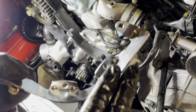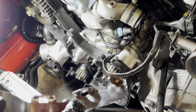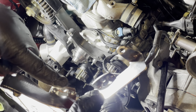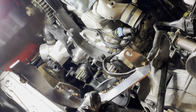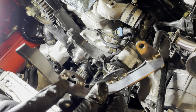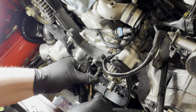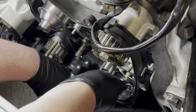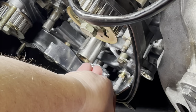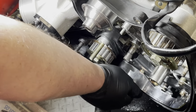The next thing to go in is this guide plate that sits underneath the crankshaft pulley - this is for the timing belt, but it has to go in first because otherwise there's no way to get it back in. It has a peculiar set of screws: one long one, a medium one, and two allen head bolts. This allen head bolt stripped when I took it apart last time - I probably spent a good five or six hours getting it out. It looks like Porsche chose the allen head bolt because there's no way to get other tools in here. I'm getting some copper slip on these bolts because they were quite badly corroded.